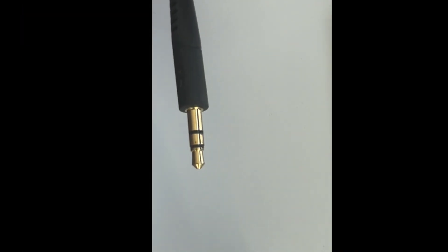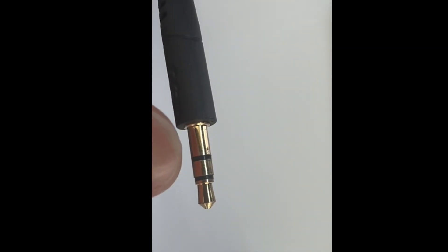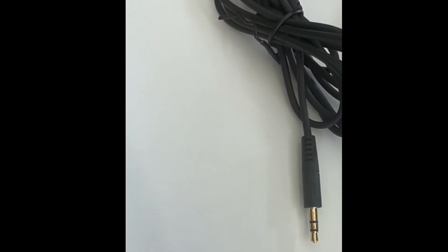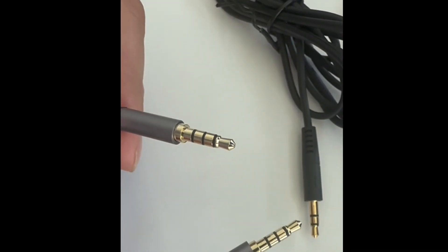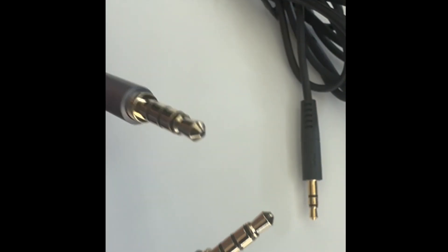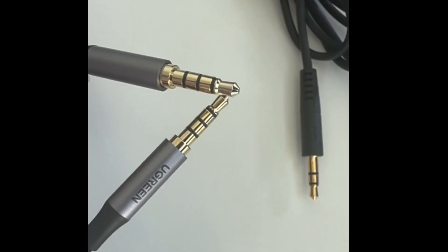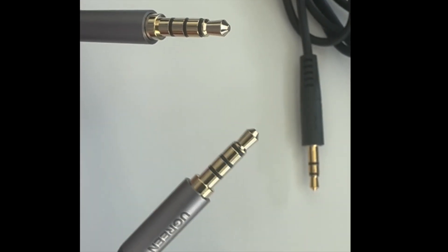One thing that got me when I got my Lulu keyboard was the cable that connects the two halves — this is the TRRS cable. I really didn't know what it was, but there's a clear difference. It looks like an auxiliary cable with two male ends. Be careful: a standard auxiliary cable with two rings won't work. Instead you want the TRRS cable — notice three circles/rings on the connector. Plug each end into the keyboard and it will work. Remember the order is important: connect the two keyboard halves first, then connect the Lulu keyboard to the computer.